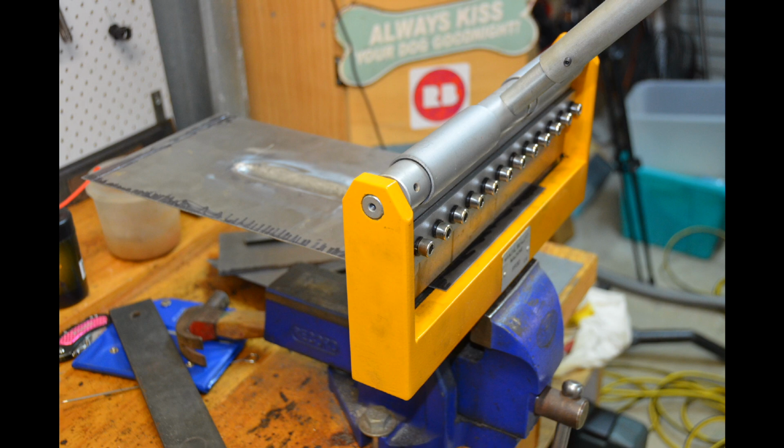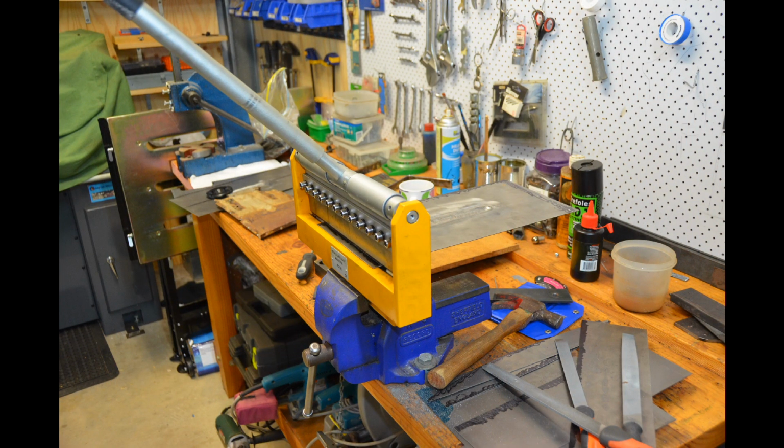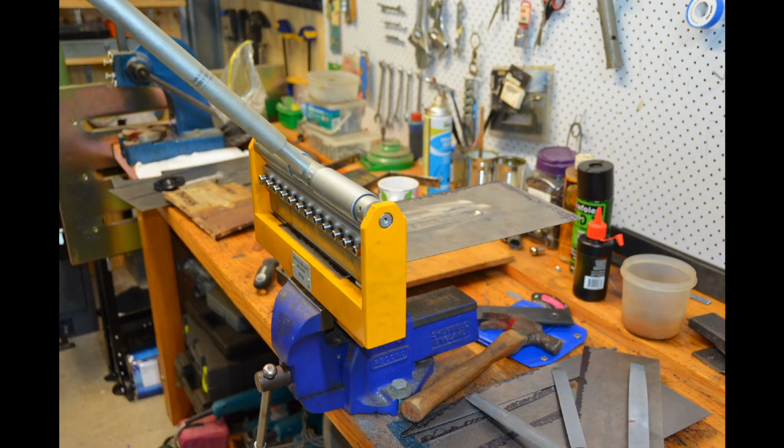Here I'm just using a cheap sheet metal bender that I bought. This particular version you can just clamp in your vise, your bench vise, so it's pretty handy really. The top half inch of each end panel is bent over, and it's that bent over bit that then gets welded into the car. In the next section of video I'll show some of the welding that I did.